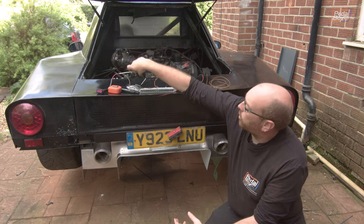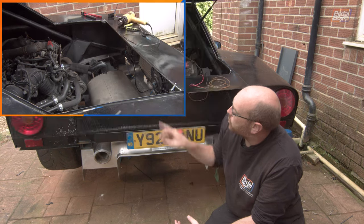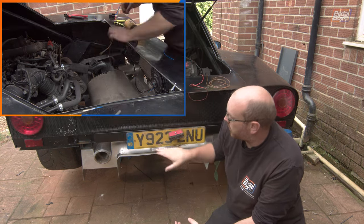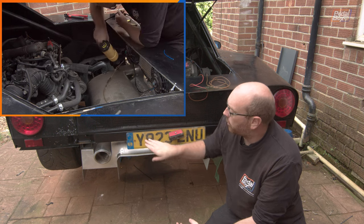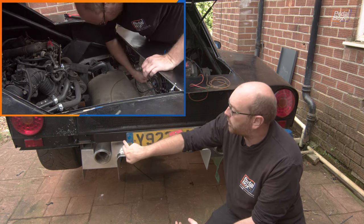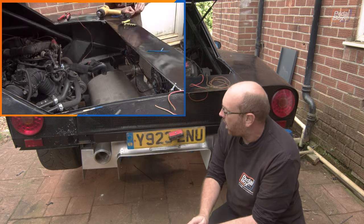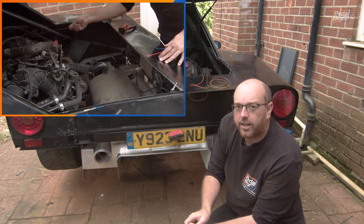First up is to build a little wiring harness for these two fans at the back — we'll join them in parallel, put a local ground into the back behind the number plate mounts, which we're also going to build this time. We're also going to do some more work on this beam to put in our number plate lights, because we have finally got the parts, so we can get a lot of things done at the back of the car.